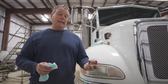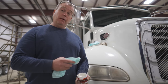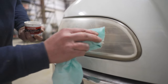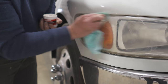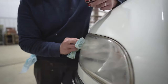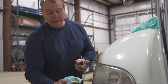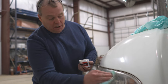I've got my mag wheel cleaner, which you can get at any automotive store. Dab a little bit on the towel and it may take a couple of applications, so we will apply it until this is nice and cleaned up. You can already see the difference. Sometimes it's hazy behind the lens, so don't be discouraged — it still will look better than it did. Just keep on rubbing. It will look better, I promise.